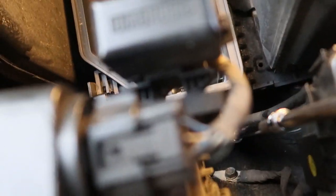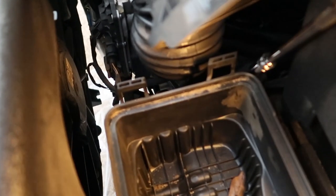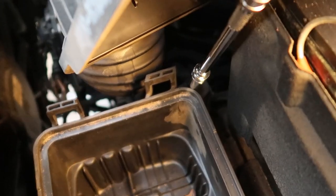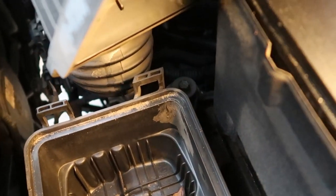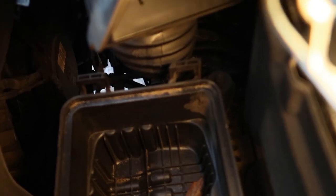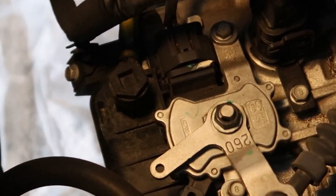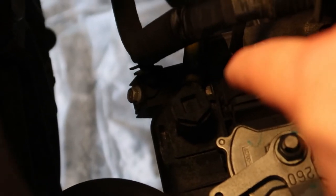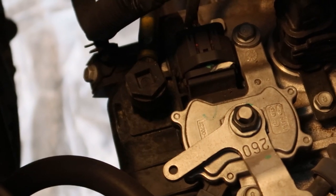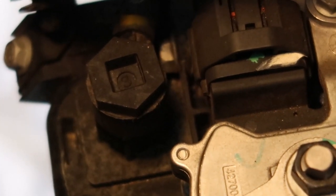At this point you're going to need a couple of extensions, or just one long one, and a 10mm socket to release this bolt right here. You can see I'm breaking this loose. And then on the other side, we're going to have to pry up on the top of the air box to get a little better access — or you could use a swivel if you wanted to. Once you release that bolt as well, the rest of the air box slides up and out of the engine bay. Now that we've got the air box removed, we have clear access to the fill bolt.